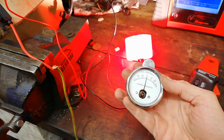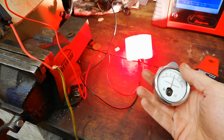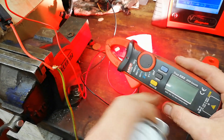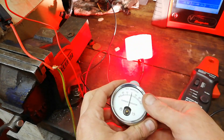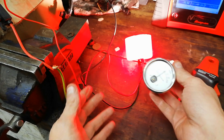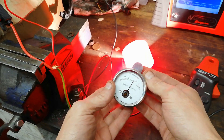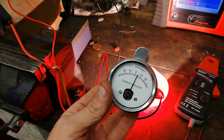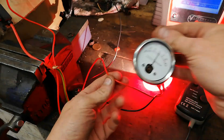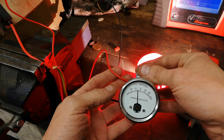Back on there, we do the analog jobby here. This then shows us the magnitude, but it also shows us the direction. If we put it on the positive, it's showing five amps — that's telling us the current is flowing that way. Similarly then, if we change it to the negative, it's now pointing that way. So it's the same as what we saw on the car there.